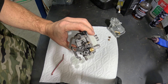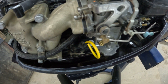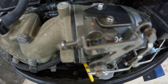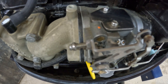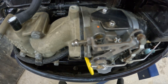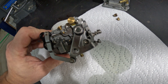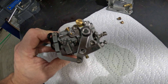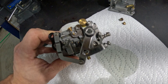There's an anti-tamper plug. I'll show you up close what an anti-tamper plug looks like on another carburetor — this is a Tohatsu carburetor. There it is right there: that little brass-colored circle — that's the anti-tamper plug. I've already removed it on the other one, but the way you remove it is to tap the center and then drill it out. Once we drill it out, we have access to that screw right down inside there. Normally from factory it's closed, so if we go ahead and spin it out about three-quarters of a turn or half a turn and retry the engine, it's very likely that will correct your problem.